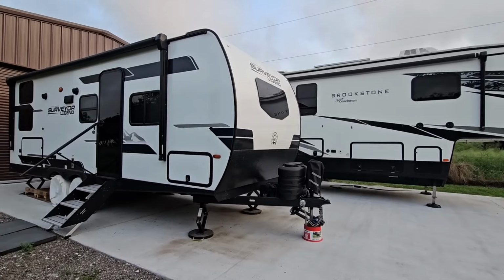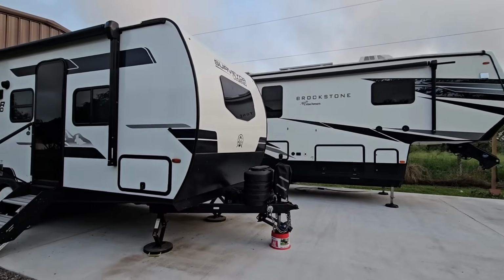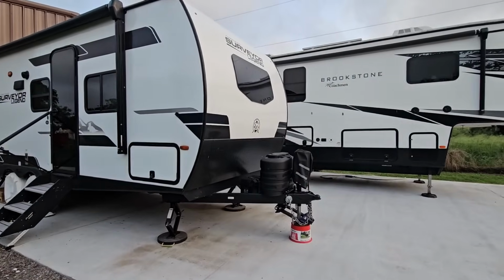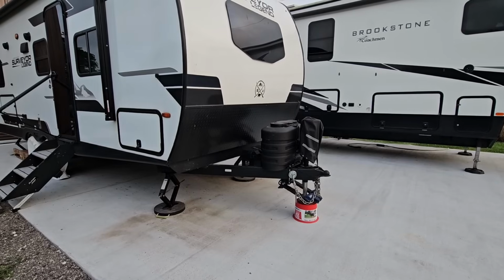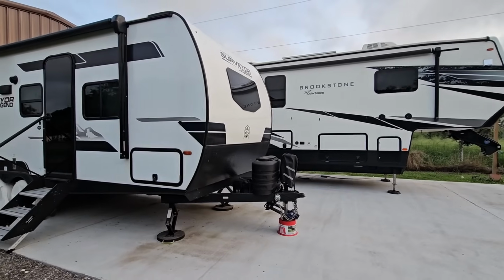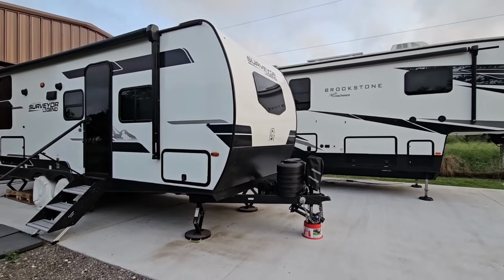If you're going to be pulling into a parking lot, let's say you're on a public roadway and you need to turn into a McDonald's, or you need to turn into Walmart, or you're just exiting, and that exit has a ramp, what are you supposed to do? Are you supposed to get out and disconnect your weight distribution hitch bars so you don't have that effect? The short answer is it's probably a good idea. Pass by, turn around, find a more level area where you can pull over briefly, take the pressure off your weight distribution system, and then approach that area.